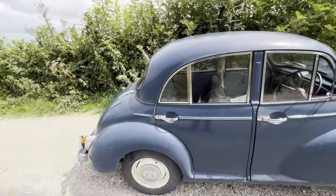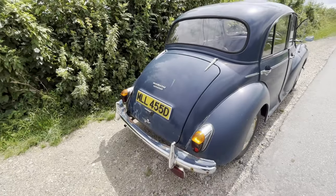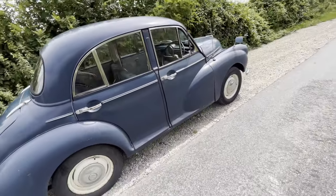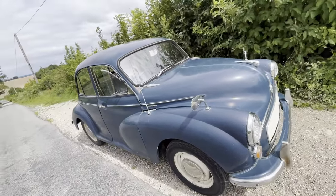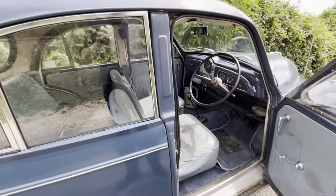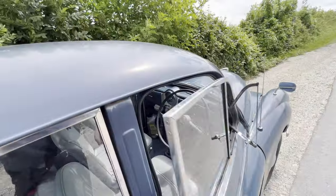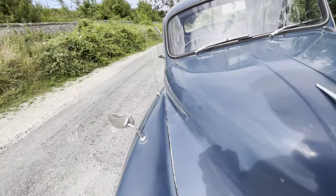What we've got going on at the moment is one of a couple of things, but most importantly the brake lights have stopped working — that's not ideal. I happened to notice it when reversing at night. I usually check to see if you can see the reflection on cars, just to make sure they're working, because with old things like this that does go wrong. Both of them are out, so I imagine it's not going to be the bulbs — I doubt both bulbs have blown at the same time because they were working not that long ago.